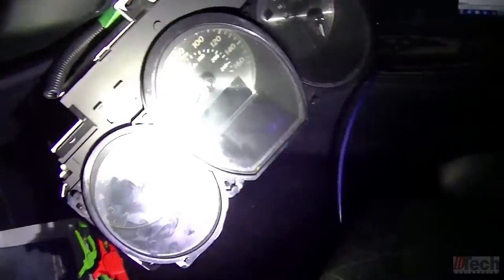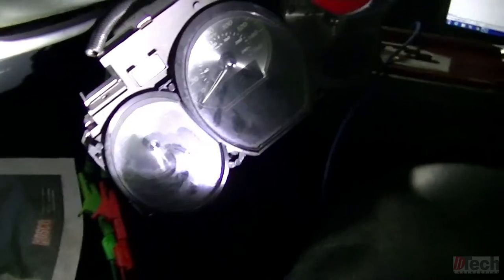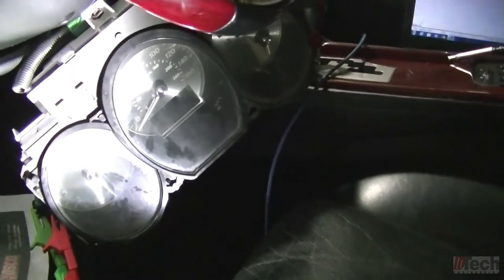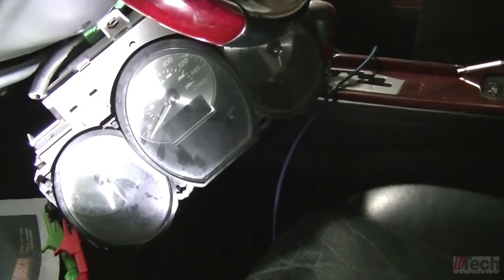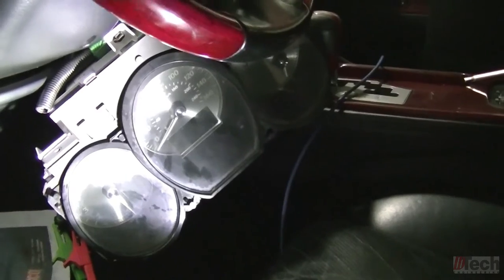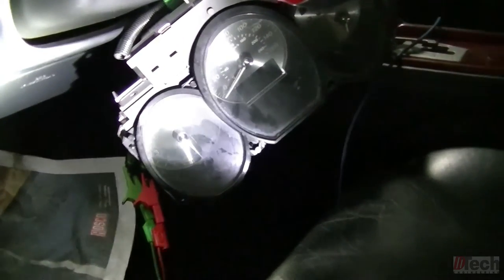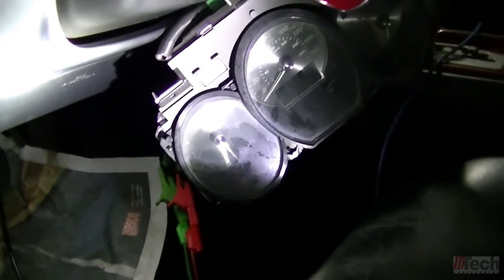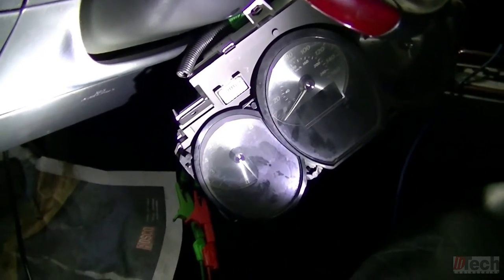If we've got a signal coming out of the cluster. We'll also, while driving, I'm going to try to see if the needle, which is the center gauge there, will actually move, which will let us know if the cluster is, I guess, accepting or processing the signal from the traction control unit. So we'll be able to check a bunch of things here at once. Signal coming in to the cluster, signal leaving the cluster, see if the speedo needle moves, and we'll check the line at the ECM also, and see what we get on all of those.